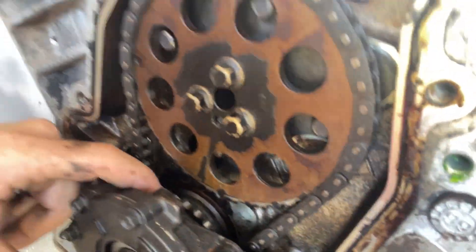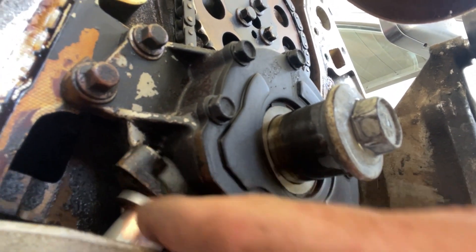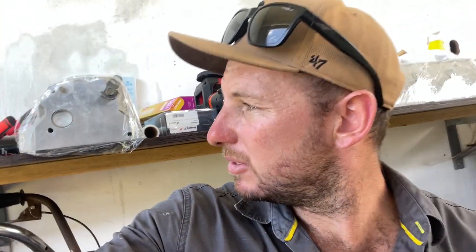I'm probably going to wait for my mate Matt to do the camshaft together so we can get the timing right. It is pretty straightforward — you can see the little dots and there's one on the crankshaft which you line up to zero, then you can start playing with the camshaft. I've also got the girdle for the oil pickup — these pickups just have one bolt, a teardrop style, and I was always worried about it, so I bought this girdle that does both sides. Today I'm going to continue with the head gaskets and getting that all cleaned up. These are all clean and ready to go. I'll probably put the front cover back on loosely and then we'll start putting the lifters and everything back in the next episode. Subscribe and catch you later.